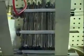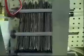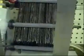Now the gaskets that we use for this are neoprene gaskets. You just buy a big sheet of neoprene gasket material. It's not expensive. Make sure it's 1/16 thickness. And the reason you want that is because any cells 31 plates or less, you can use a 1/16 plate gap and it works perfect.